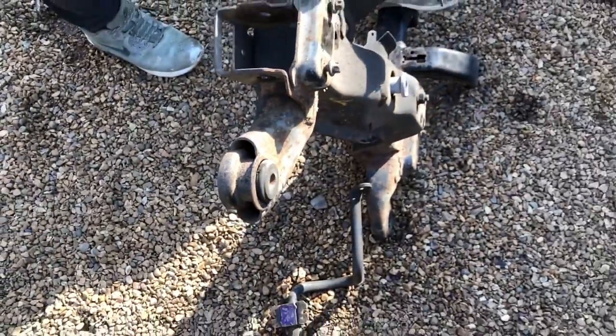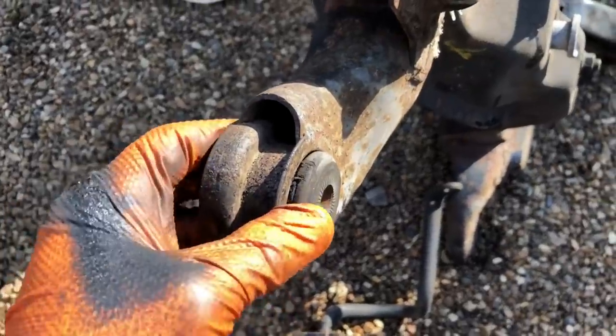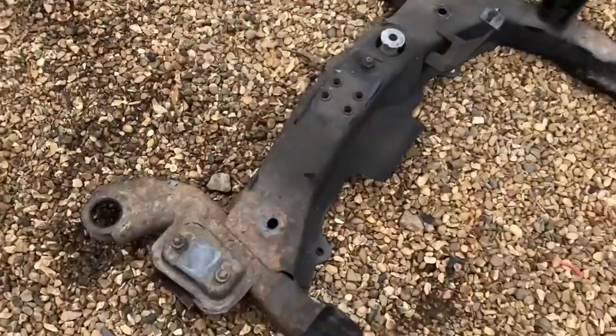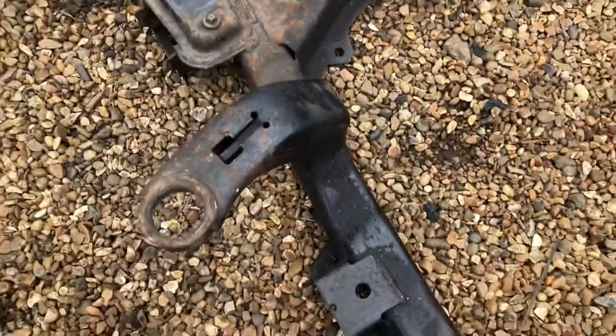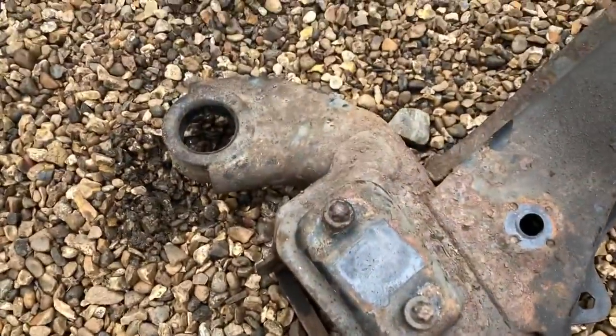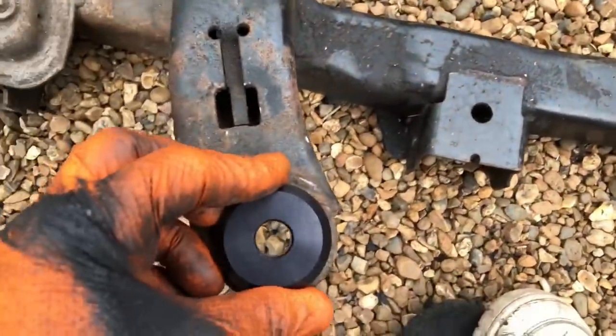Getting the solid ones on there is going to make an improvement. I love seeing products that are worn out because you know you're going to have a bigger improvement when you put the new ones on. Subframe bushes are out. I'm just going to give it a clean up now — quick clean up around the bushes so we can get them in there nicely. Because of the corrosion they don't sit in there properly and flush, so a little bit of paint and then it can go back on.